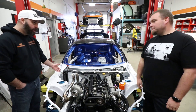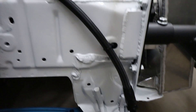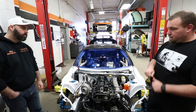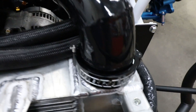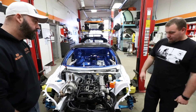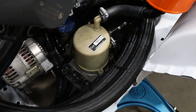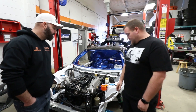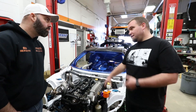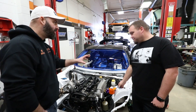There's a new giant Vibrant catch can with a dipstick and tons of capacity. It has a drain line routed into the wheel well so you can turn the wheels full lock and just drain it — a really nice setup. The charge pipes have HD clamps. For power steering, they pulled an electric power steering pump out of a Mazda 3 — incredibly cheap, around a hundred dollars US — and bought a couple as spares. It's plumbed into the new S chassis steering rack.